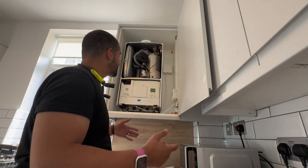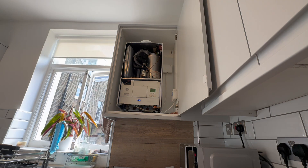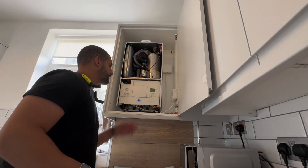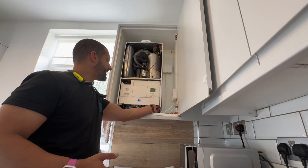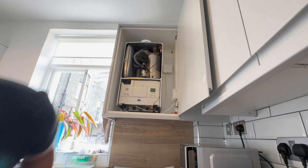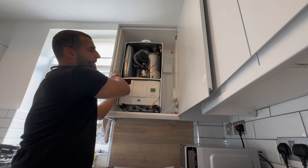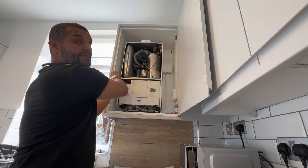As you can see, the boiler's back up and running, temperature's staying solid - 63 degrees. So yes, it was the pump gone. Showed you how to diagnose that in terms of wiring - the pump had power and wasn't coming on. So a successful repair - hopefully you enjoyed it and hopefully see you next week.